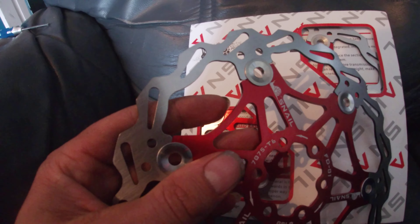These are 180mm. They're 7075 aluminium, by the way, with T6 heat treatment — if anyone's interested. Unless you get it stupidly hot, then you might re-heat-treat it to something else, but if you do that, what disc brakes you've got on there are the least of your worries.